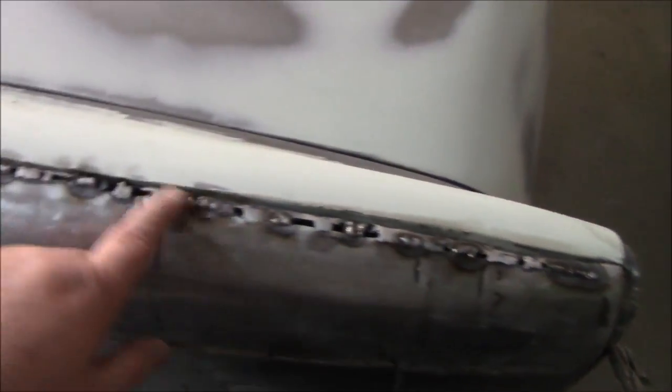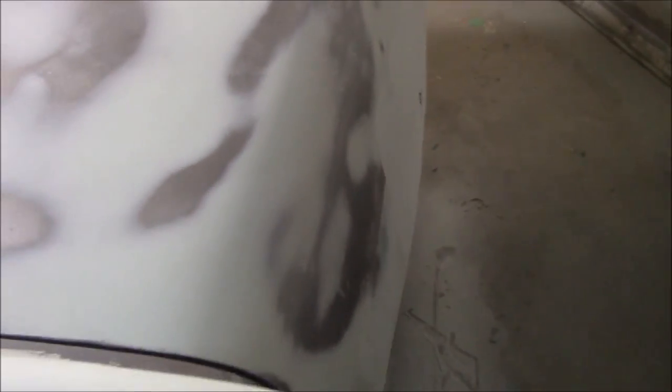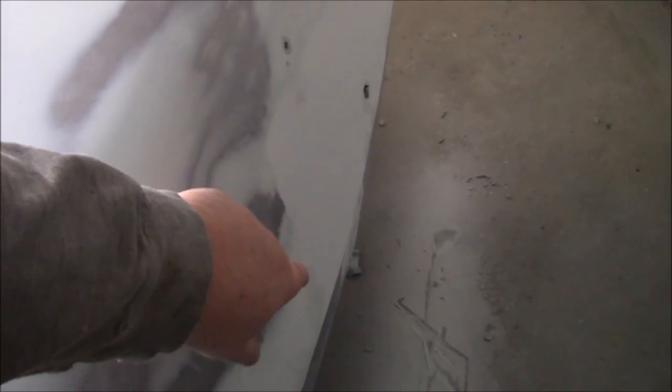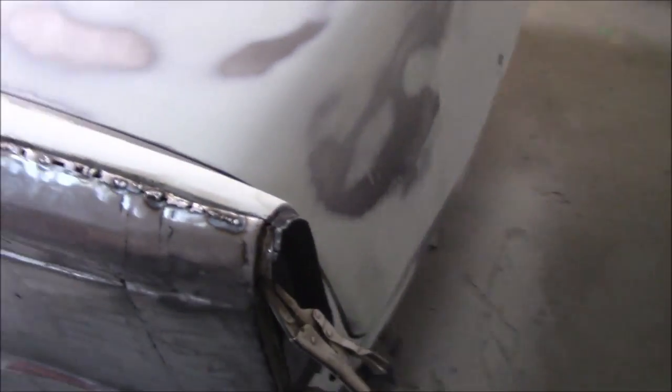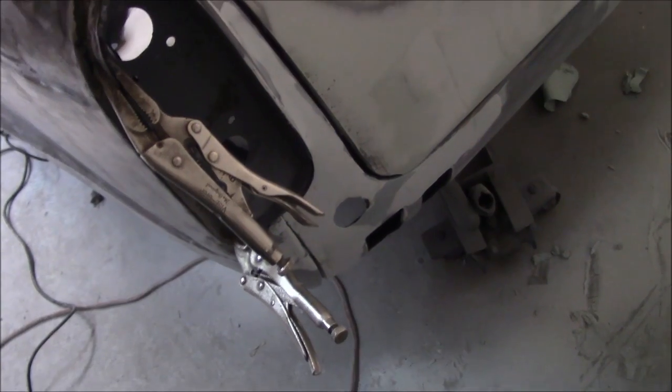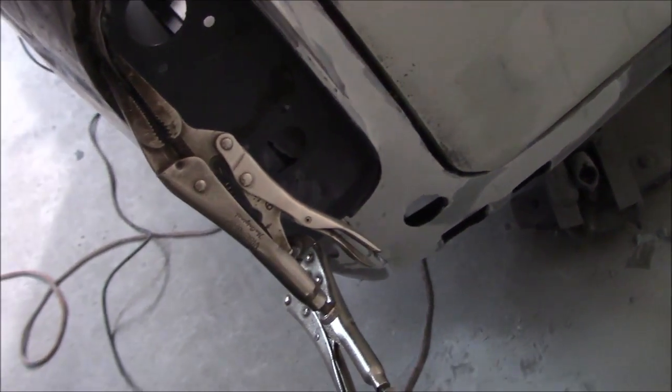I've been doing little bits here and there as a break from sanding, trying to keep it cool and not warp it. We're going to continue sanding the area where I put the last application of filler to try to get rid of a low spot there. We might throw a little guide coat on that area to help identify where we need more filler.